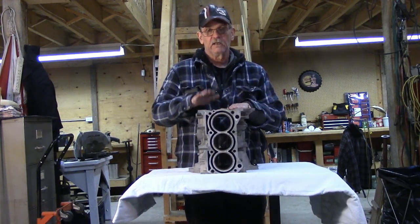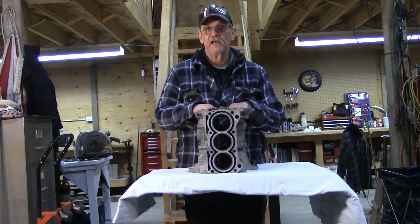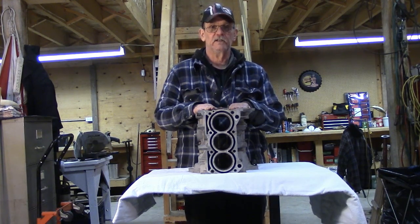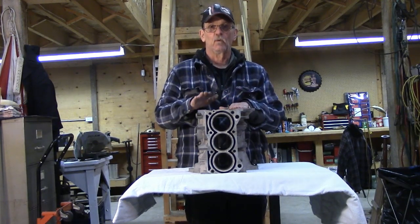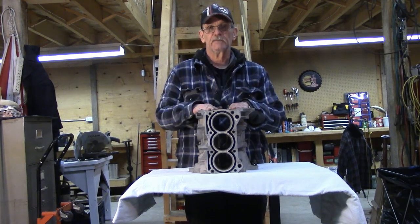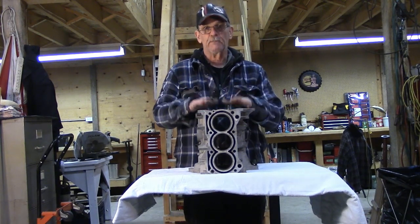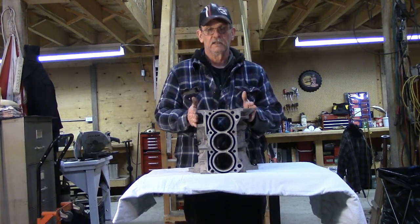What's interesting is that from the factory, this little monster is 60 horsepower, but we can actually build it out to a hundred horsepower. A hundred horsepower per liter is attainable with just about any size of engine. This one is a one liter, or one thousand cc's. The V8 that we showed at the start of the segment is a five liter, which means yes, you can have a five liter and make five hundred horsepower or more. This is the base — everything you do is built off how well you build the bottom end, or the engine block.